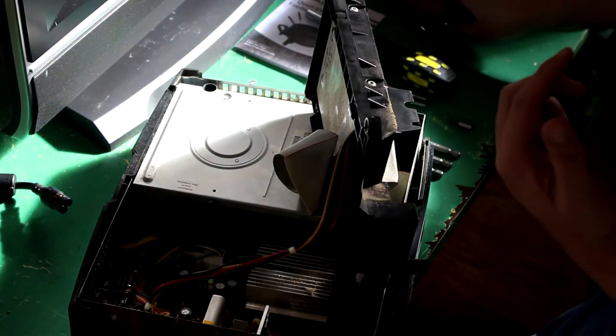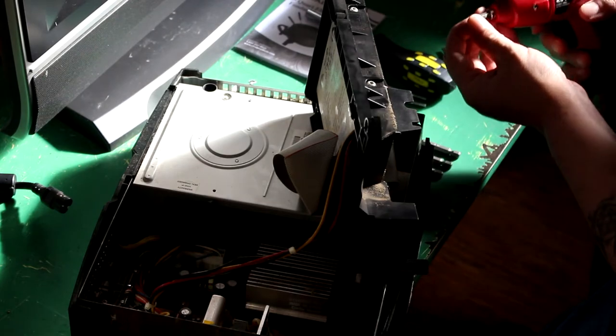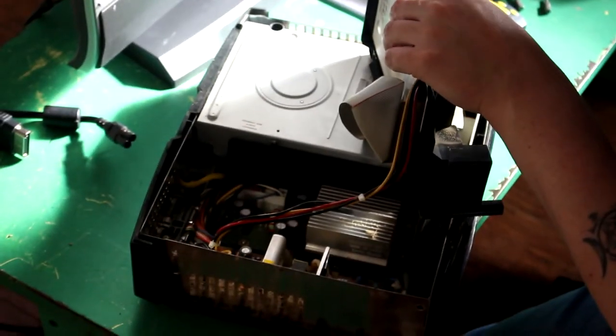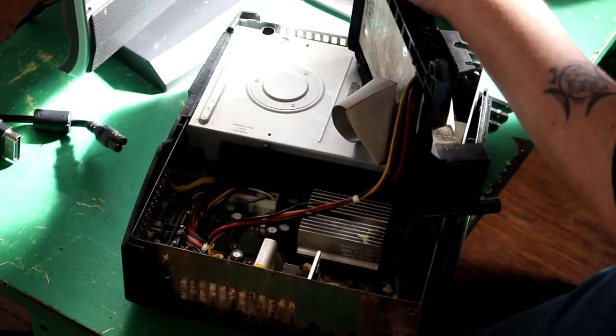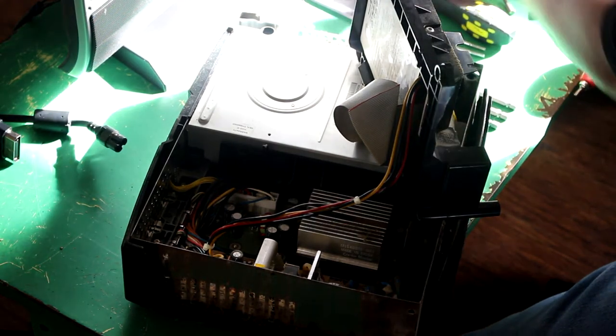Yep. There's a lot of dust in this system. You're the expert here, so I'm assuming that what I just said makes sense, but tell me if it doesn't. By the way, this is an Xbox 1.6, therefore it cannot be TSOP flashed. It could only be soft-modded or use a physical mod chip like an Aladdin, or an Executor or something, if you can find an Executor.